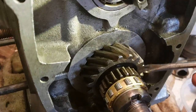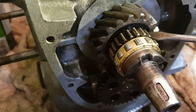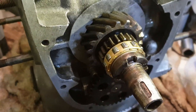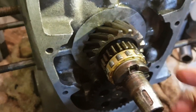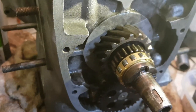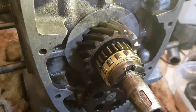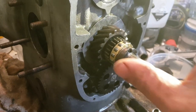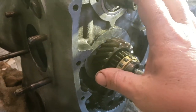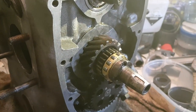So finally, we put on the oil pump drive sprocket, or gear, followed by the generator bearing, a nice SKF Explorer M1 with its brass cage or bronze cage, followed by a washer and the left-handed thread castellated nut. Right, that's it for this side. Next thing we're going to do in the next video is set the timing, put the flywheel on, and that sort of thing on the other side.